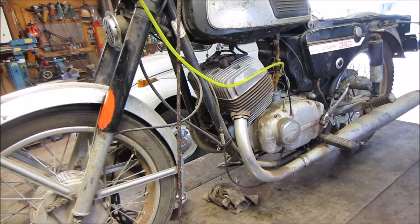You've got to decide what level you're going to take stuff to. My thought was: by cleaning up the paint that was there, the rest of it kind of matches. If you repaint it and have nice clean shiny paint but then exhaust and wheels that look worn, it's just a mismatch. That's why I was trying to go for the original look and not get into too much painting. The frame's got bumps and bruises — we can black that out — but the cases are not going to look spectacular when cleaned up unless you totally disassemble the engine, sandblast everything, scotch-bright them back, clear coat them. I am just not willing to devote that much time to something like this.